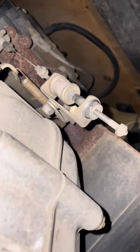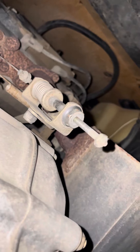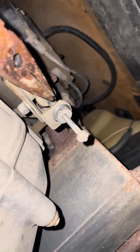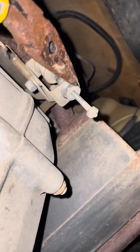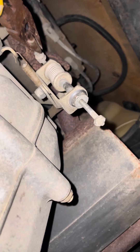Okay, so this is your governor right here. In order to adjust it, this is the spring that you want to compress. And you compress it by turning this screw right here, or this nut right here, just righty-tighty, and it'll just move this bar all the way forward.